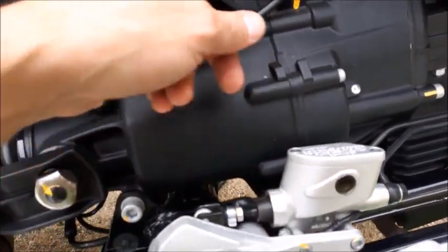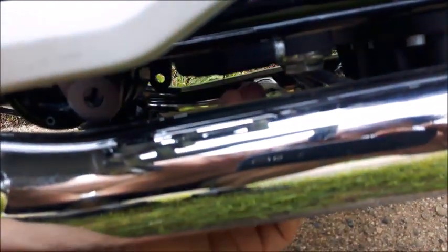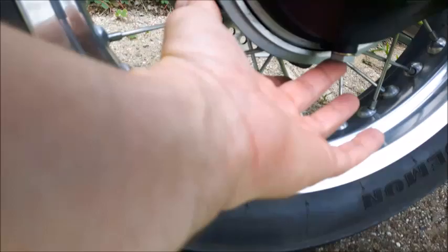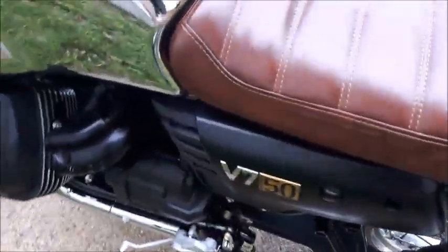This is a six speed, so there's your filler plug for your transmission, and there's the big drain bolt. The engine's right there and there's your oil filter. The rear end is pretty straightforward — filler plug there, drain's right there. And of course the filler cap for the oil is right there.